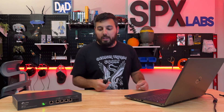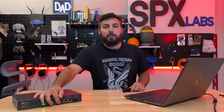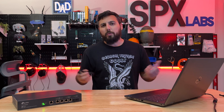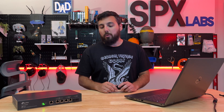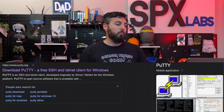I'm going to show you exactly how I like to do that. Most of the Jetstream switches come with a serial port on the front, as well as a micro-USB port. Today I'm going to be using a USB to micro-USB cable to interface with the COM port on the switch, so we can do the factory reset. We will also be using PuTTY to do this. PuTTY is a free application you can download online. It works great on many different versions of Windows. I'll be using Windows 11 today.